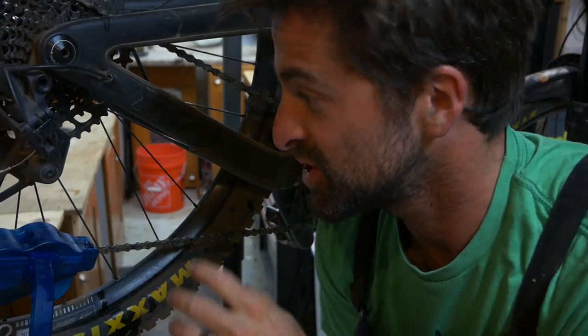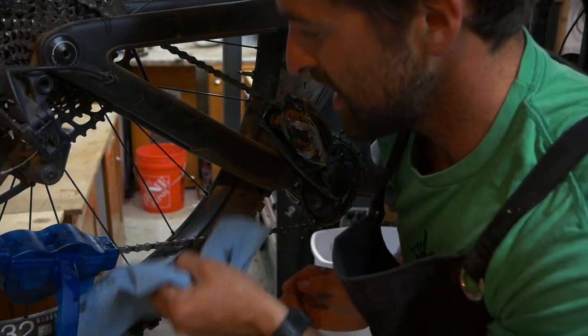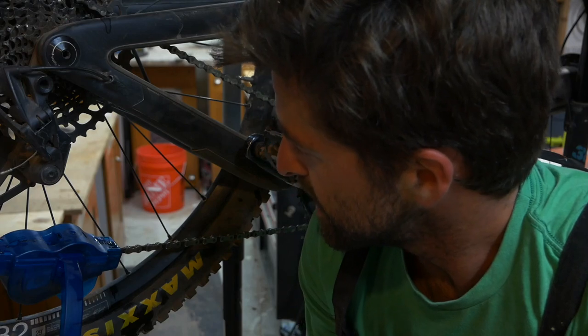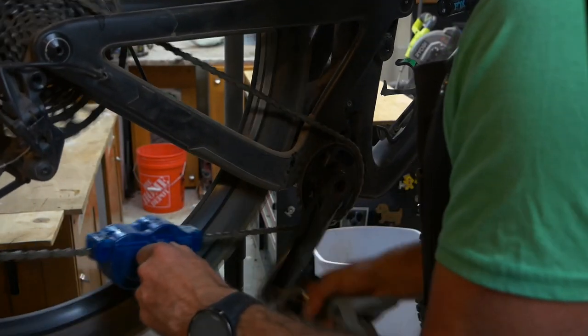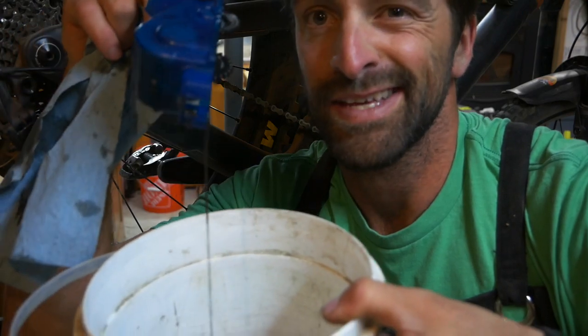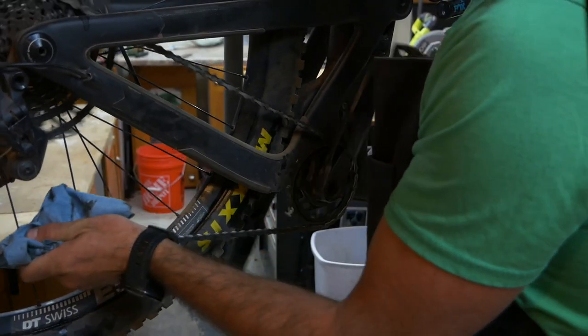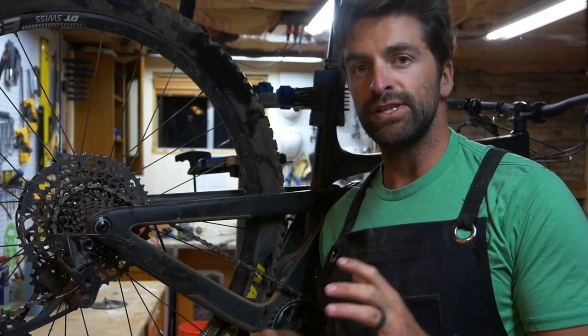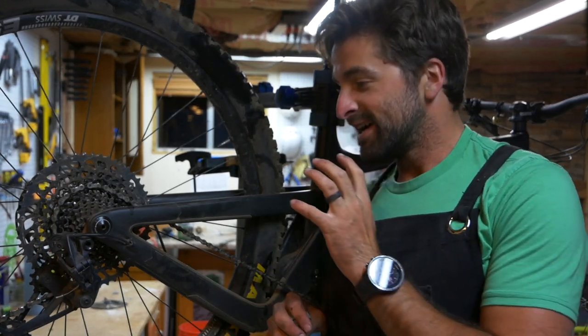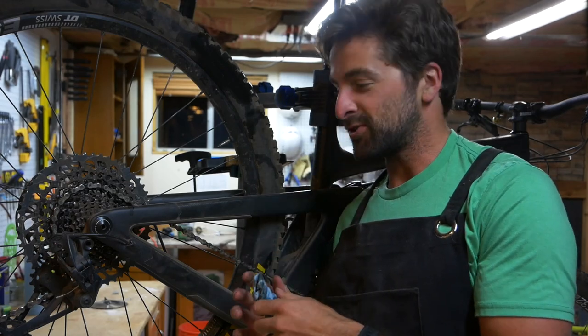After a couple minutes you'll see all the dirt really come to the surface on the chain — it goes much darker. This actually cleans the chain pretty well, despite me hating most bike tools. After cleaning with whatever degreaser or soap you use, it's fine to spin it dry in the shop, but make sure you put some bike chain lube back on before you go for a ride — otherwise it'll have no grease and will actually do very poorly on the trail despite looking clean.